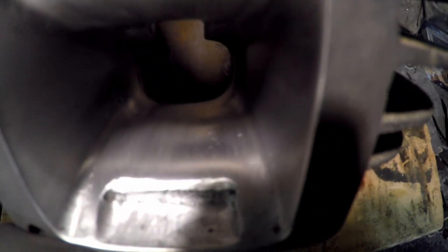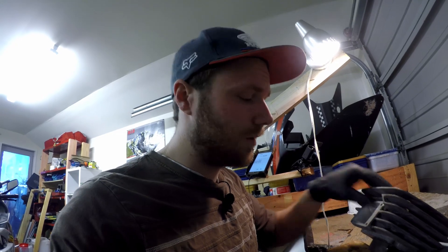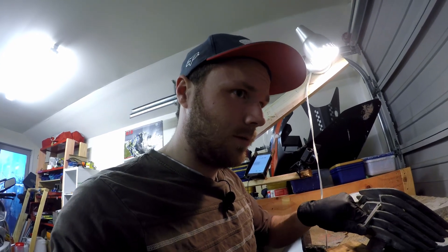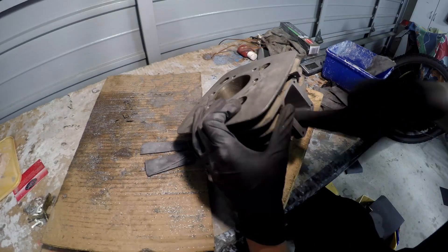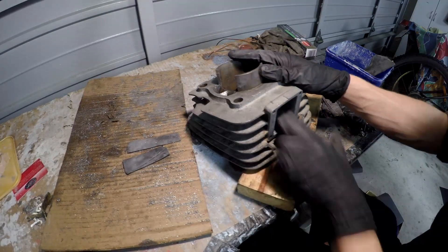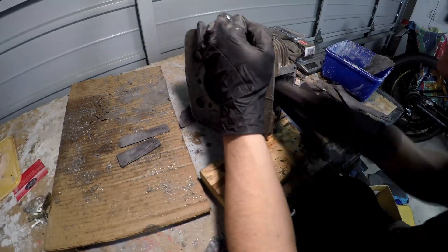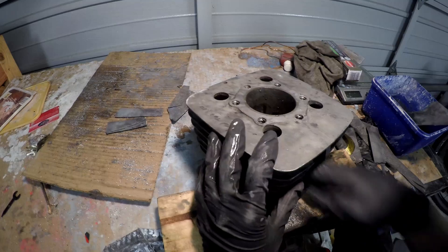After many hours of sanding, our intake is looking pretty darn spiffy — all the walls are super smooth. There are a few imperfections on the floor from the casting that I won't be able to remove. I started off with 120 to 180 grit and now I'm moving on to 400 grit to see how that goes. A couple of things I'd definitely recommend if you're sanding by hand: wear gloves, because otherwise you may lose your fingerprints. I'm using wet-and-dry sandpaper with water to help remove the material.